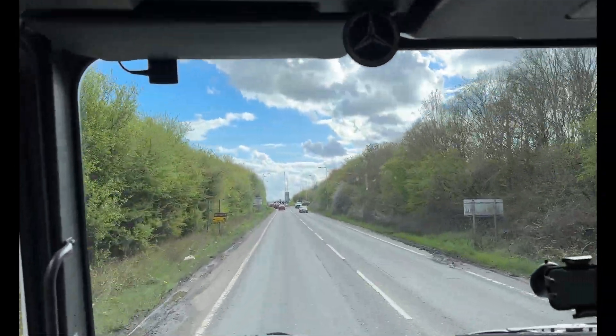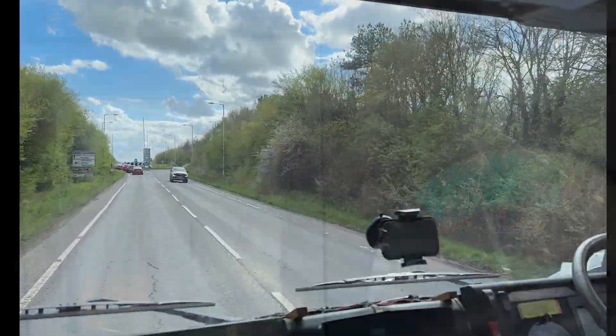Okay, so it is a test drive in Smog to see if that little repair has actually fixed this problem. This issue doesn't come on instantly - it takes a few miles to do and it's when it goes up certain gradients. It's not heat related either because if you cycle the ignition the problem goes away for the same amount of time, so it's definitely some kind of limp mode. Right now it's absolutely on it and sounds incredible. Let's get some heat in it and some miles on it... and it has just fallen into limp mode again.